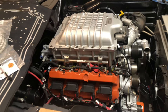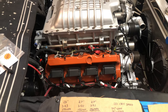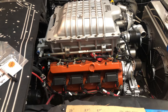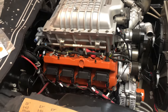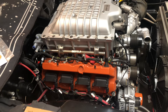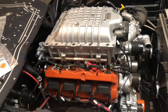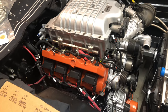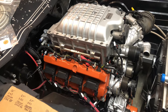Here's what I'm looking at right now. I think I narrowed it down mostly to looking at the failures we've been seeing on other cars on the internet. They seem to be critical speed related to me. I think there's a little more going on other than critical speed too, but the type of failures people are experiencing are down track at the end of the track at higher speeds — catastrophic failure destroying the output shaft and the casing around it — which typically seems like a critical speed issue.